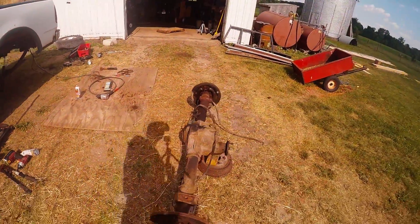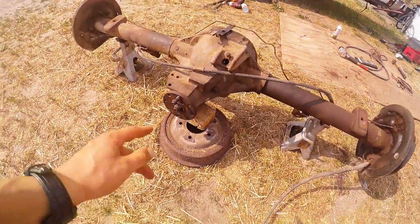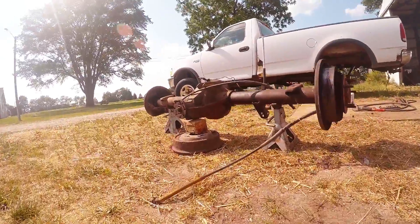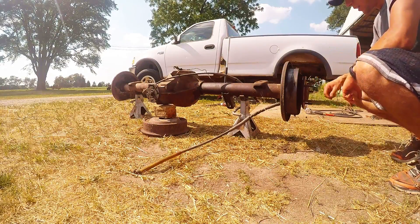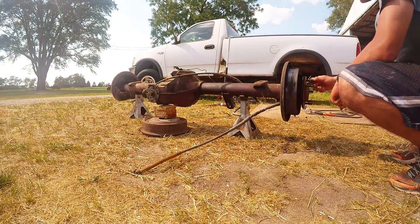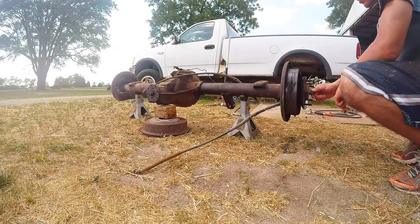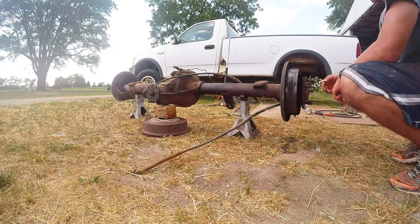What if it's not there? What if you're trying to get one and you don't know what kind of truck it came out of? Well there's an easy way to tell. I got a bolt in the flange there at the top center, and a lug nut in here. We're just going to twist it over. I got a mark here about where this lug nut is at. We're going to turn the whole hub one time and count how many times the flange turns. Here we go — one, two, three. And we're done. It's about three and a half — 3.55 gears.